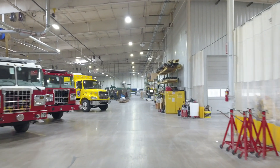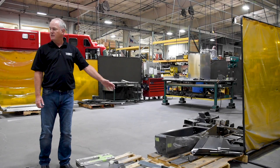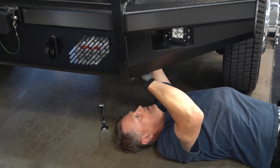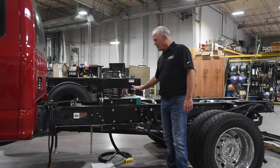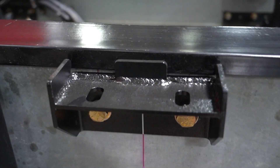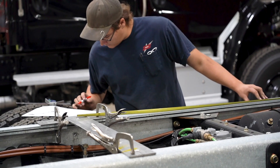While your body is being fabricated, another part of our line up-fits and preps your chassis for mounting. We have our chassis fabrication area — this is where all the body mounts, front bumpers, and chassis components get built. Front bumpers are designed, built, painted, and installed. During the chassis up-fitting process, we mount PTO-driven generators, body isolation, and body mounts. Our spring-mounted bodies allow for free chassis movement without transferring torque into the body panels. Along with our commercial chassis line, we also have a custom chassis line. We do a lot of work on both Spartan and Sutton chassis.